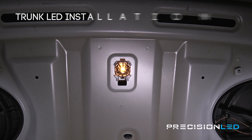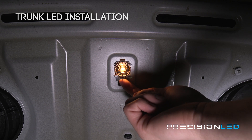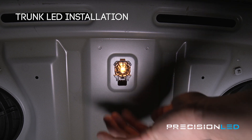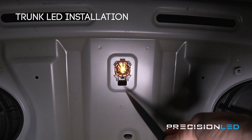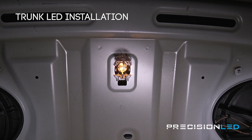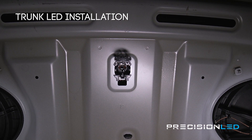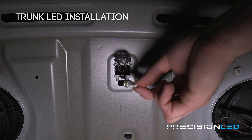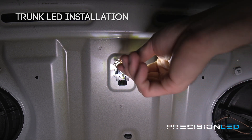Now we're installing on the trunk light. This halogen bulb is actually very simple to access — you just need to remove this one clip right here. You can remove it with your bare hands, but we're using our pointed wedge tool to pry that clip outward for a better shot. Now you can remove the bulb with your bare hand but be careful it will be hot — in our case we're removing it with a rag. Here we have our premium 5730 style LED, so we'll just pop that in and reseal the casing.